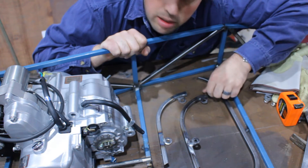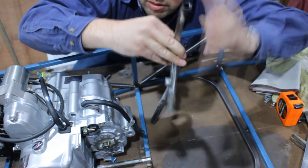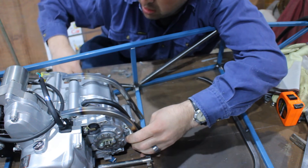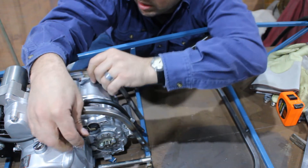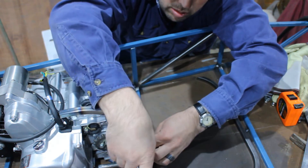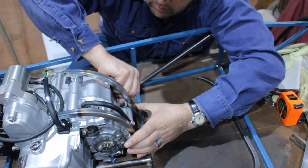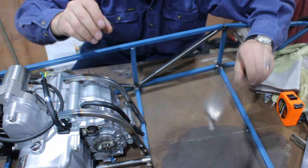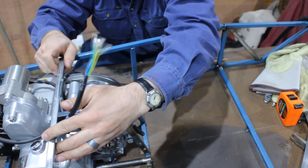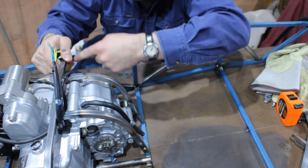These three main pieces are made for the engine mounts — fairly simple, one up each side. One of them had to have a 10mm packer built into it because for some reason the engine mounts aren't the same size top and bottom. Got some long bolts to go through the lot. Then this top bar — I'll get the wiring out of the way — goes through here, and we're there. I just need to tweak it a little bit and make sure the ends are right.